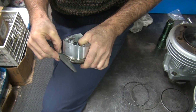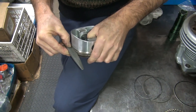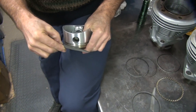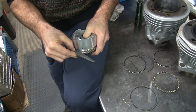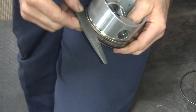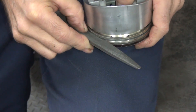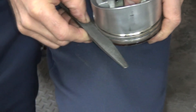This is not going to work very good either, because you can't really hold it flat. So I'm going to wind up in the lathe anyway. Let's not mess up that bottom lip. I'm hitting the high spots on something - or maybe I'm just digging in the other groove. But I'm not filing on the other groove, I might just be hitting on it. Just rounding it off a little - chamfering the edge, with a sharp edge on it.